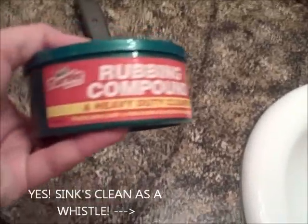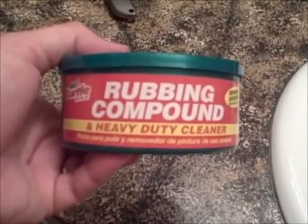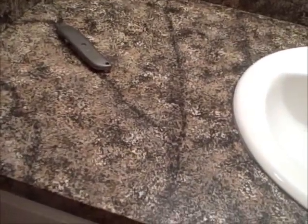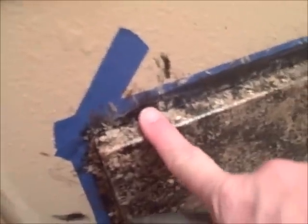All done. Got myself some rubbing compound after the 1500 and 2000 grit sandpapers that I did. Then I did my rubbing compound, and it has a gloss to it right now. It's not buffed. I need to buff it. The beautiful thing you can't tell is that when you touch it, it's smooth as glass. Smooth as glass. Now, it'll be shinier soon. It'll be really shiny once I get the, what's it called? It's late. The buffer.